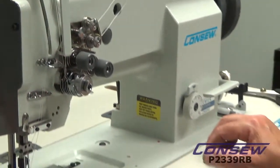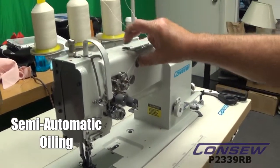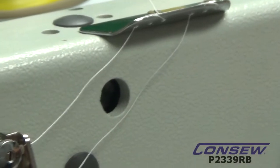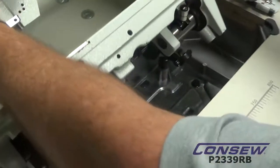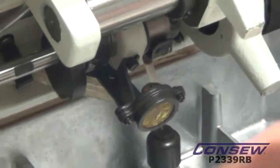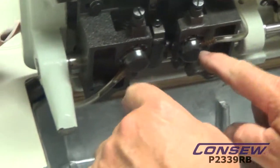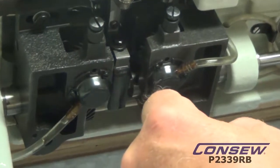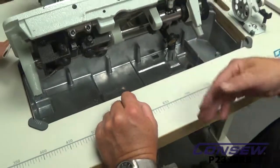We have an oiling system on this machine that is a semi-automatic oiling system. It utilizes a wick feeding system with a reservoir located right here with an indicator where you fill up, and it helps oil the whole top head. You have some small places to oil which are marked. As we tilt the machine back, we'll notice there's a pump pickup here that oils the bottom side of the machine, and there are wicks and pipes that come over to your hook assembly, which actually oils your hook. You have two micro valves that you can adjust to vary the amount of oil that comes to the hook, with a self-contained oiling system and a pan that recycles the oil.